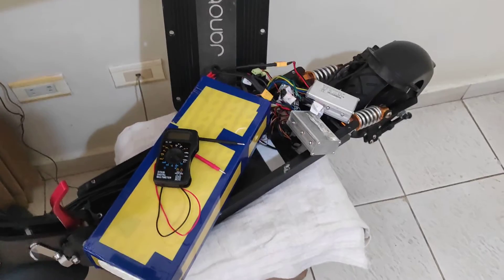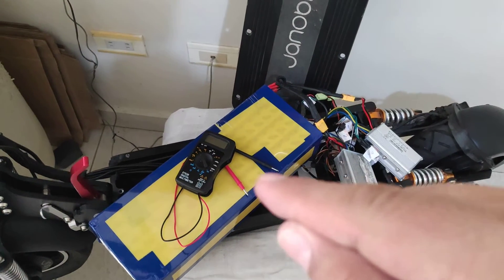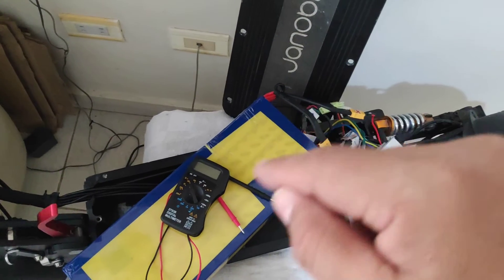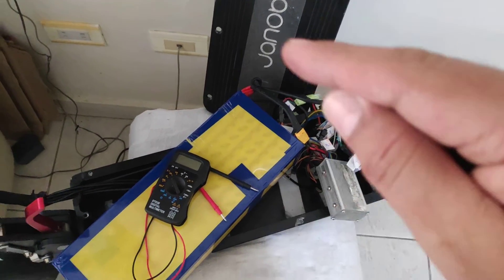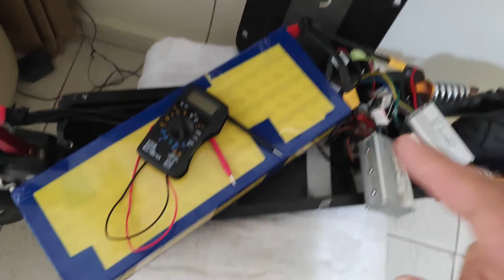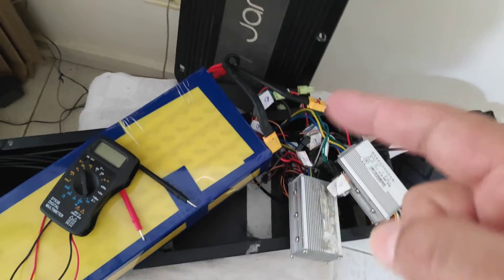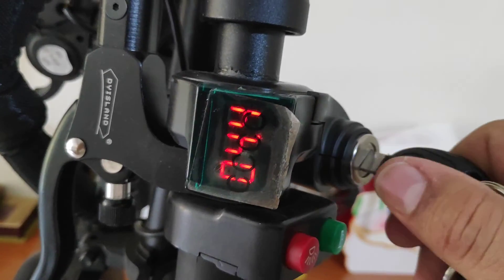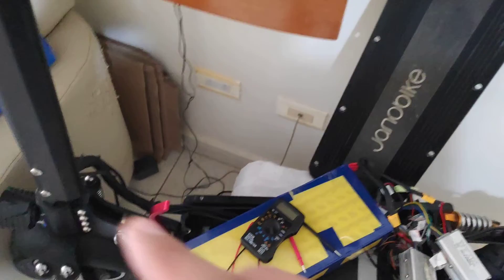The technician charged it, all the cables were connected internally to the battery. When we measured the negative and positive poles inside the yellow and blue box, it gives me 52.2 volts — it's in perfect condition. But it delivers to the controllers only 38.2 volts; that is, it blocks. After some time connected, it unblocks again, I turn it on again, but as you can see, right now it's not unblocked — it's not delivering the necessary volts and it shuts off; it can't turn on.